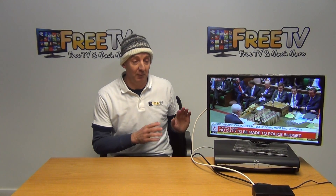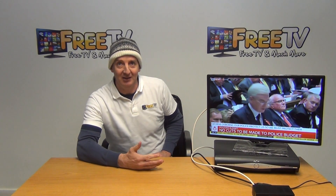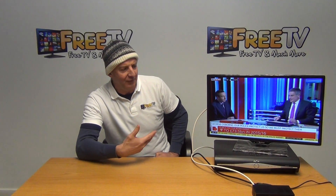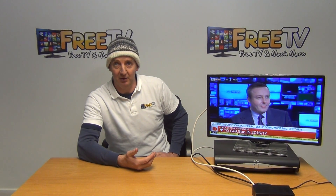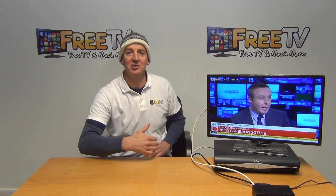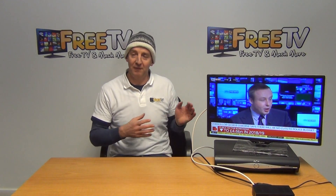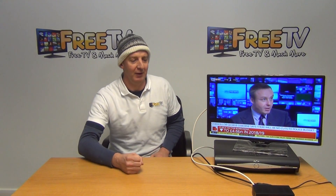In terms of picture and sound quality, I find it good for the vast majority of applications — it'll work absolutely perfectly. One thing to be aware of: if you're feeding this into a television that has only a digital tuner and no analogue tuner, it won't work, because you'll be sending an analogue signal to a TV that can't receive it. Most recent TVs have both analogue and digital tuners, so for the vast majority it will work — just be aware of that.